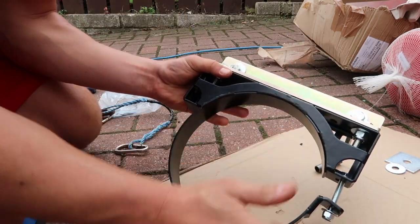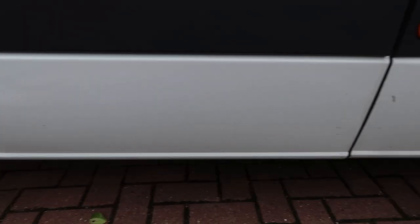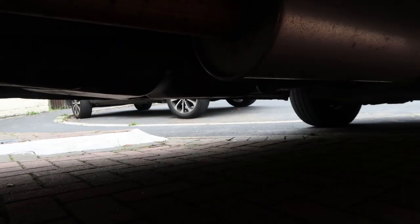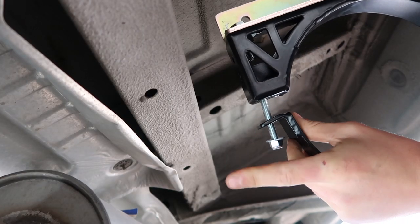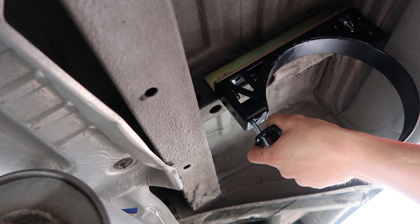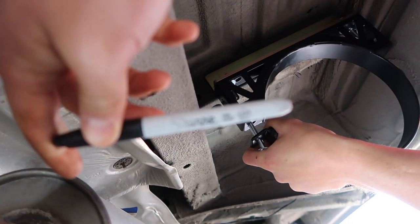Then with the longest bolts in the pack — right, this is around about the area you're seeing. From the front door, you want to be going under the van and looking towards the front of your van. You'll see this member here — you want to offer up your black bracket with the open end facing the middle of the van. That is where your tank will be slotted into.